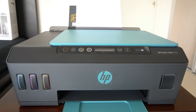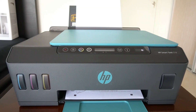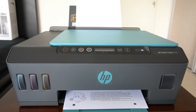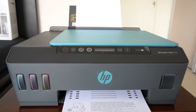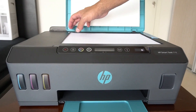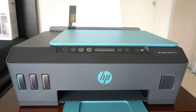According to the instructions, the next step is about testing the scanner. What it does is scan the alignment page for the printer. Once that's done, you take this out, open the scanner, make sure the page goes to the edge - the edge is highlighted on the top right-hand corner. Then close it and press the copy button. I've done the color one, so I'll press that and see what happens - I can hear the scanning head moving.